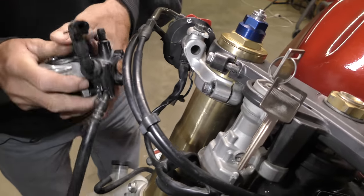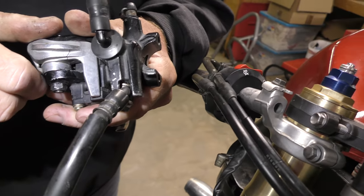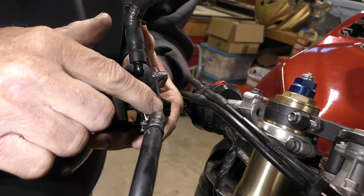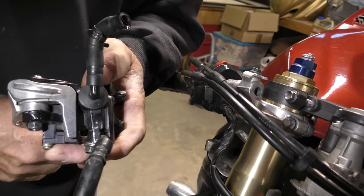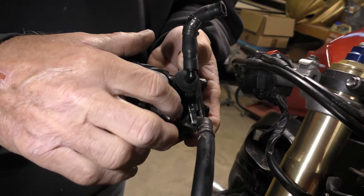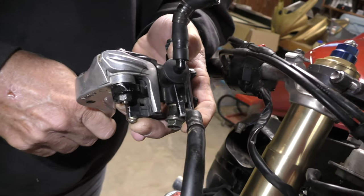Because we can't clock the line. The line is secured by two metal castings. So now, being ingenious, you want to go, oh, well, that's easy. I'll take it out of that and I'll put it in here, but you can't. When that goes in there, and trust me, we tried it, the brake line stops the brake working. You get literally that much motion on the brake lever.